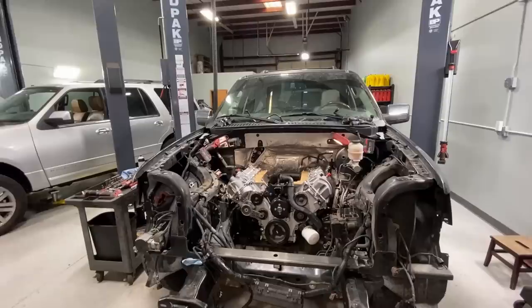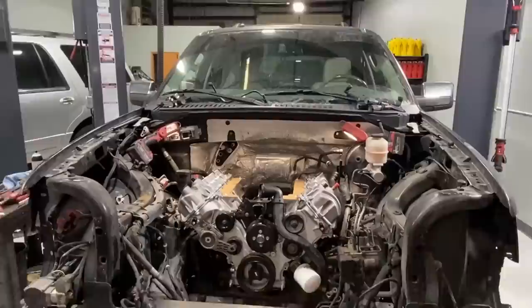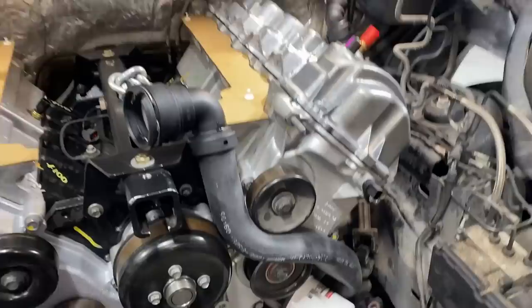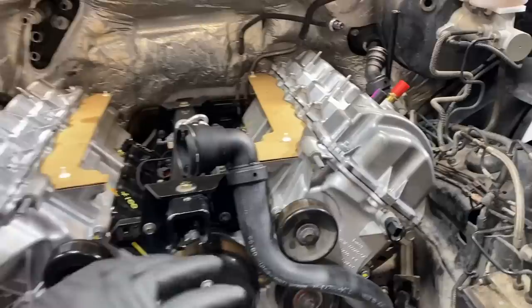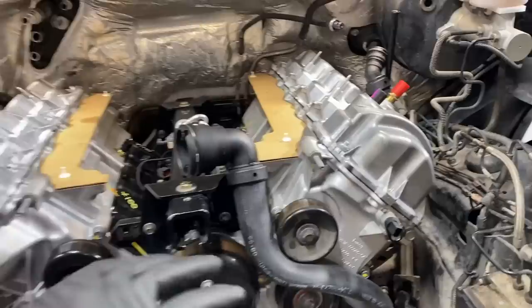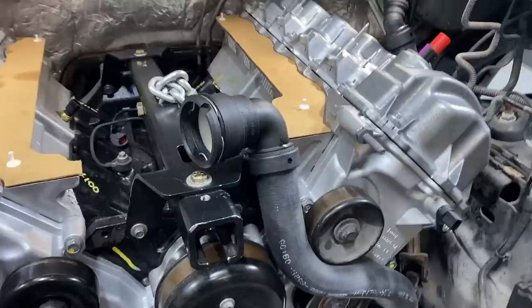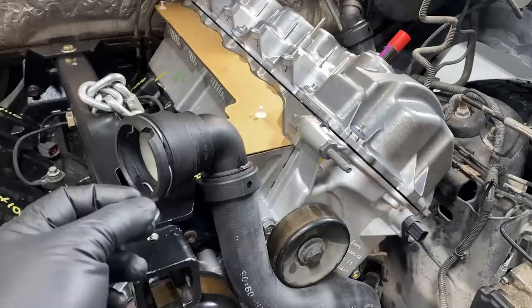I'm doing them back to back, so all the same shop equipment is out, same tools in the cart and all that, which makes it a lot easier and much faster for me and the customer in the end. Real quick, I want to go over a couple of things. Ford on the newer vehicles - on just about everything - they're using these quick-connect coolant hoses. For years Ford used them for the heater hoses only and there was never a problem, probably 20-30 years. But now they're using them for everything - the coolant crossover, the Y-pipe, the degas bottle hoses, all that stuff likes to leak. Now they're using them for upper and lower radiator hoses.